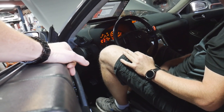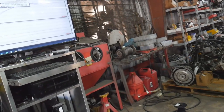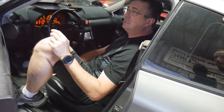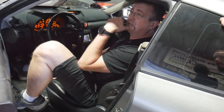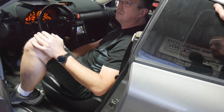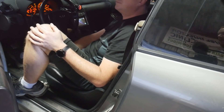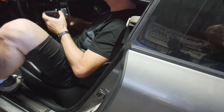We're at 91 right there, 555 torque. Gap the plugs — what do you have right now? Oh, at stock, regular gap? For NA that's fine, but whenever you go boost you obviously have to gap plugs. So if you're at stock gap, you need to bring that down to at least 0.028 or 0.026. At this point you're pretty much maxing what 1050X injectors are capable of on this dyno, because this dyno reads on the very low side. I'd probably see around 600 on another dyno — that's usually where I stop on a six-speed build on 1050Xs.